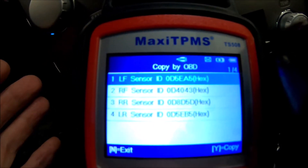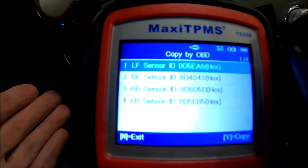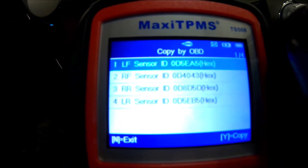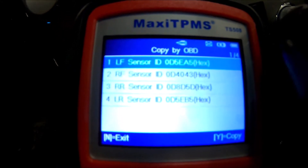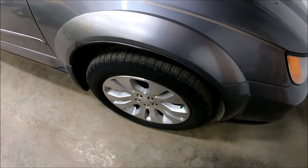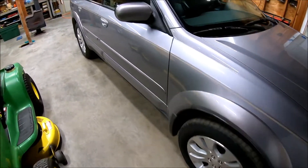I've got all the information I need. Now I need to break down the tire - which I just had new tires put on - I'm just going to try and break the top bead, get the sensor out, program a new sensor, and put it in the tire. They're kind of a low profile tire so they might be hard to compress down far enough to get that sensor out without taking the tire off. This right rear tire is the only one that's reading right now. All the other ones are dead, even though I had two good sensors when I took this car in. Now I've only got one that reads - assuming all the batteries have gone dead, and this one's probably on its way out too.